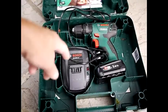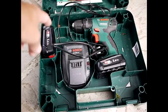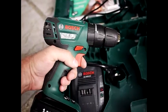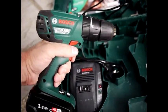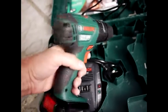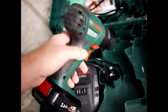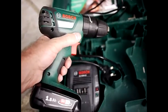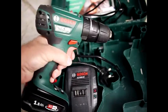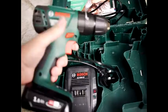The drill will not be charged when you get it — it may have a little bit of residual charge, but it won't be fully charged. When you pick the drill up there should be a small amount of charge in it and it should spin. If it doesn't, you've got a problem. But check the reverse and forward switch — if it gets stuck in the middle it won't move, so make sure it's switched before you try it.